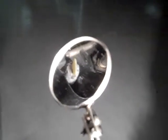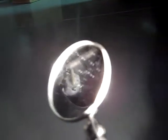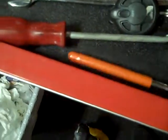Really junky. After a couple times I use them, they start getting screwed up, and this one actually popped out on me when I was driving down the road. We lost all my coolant, almost overheated the car, shut it down before it got too hot, and called my dad. This thing is basically all water now, and I put some water wetter because this is Florida. It isn't New York anymore, so I don't need to run antifreeze because I don't have to worry about it freezing up. So I did that, and then I epoxied all around that drain, so if it ever pops out, it probably won't now because there's a lot more pressure it's going to have to overcome, so I won't buy a radiator for that.